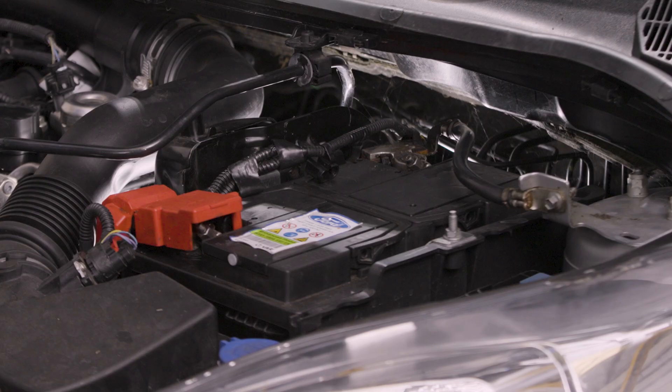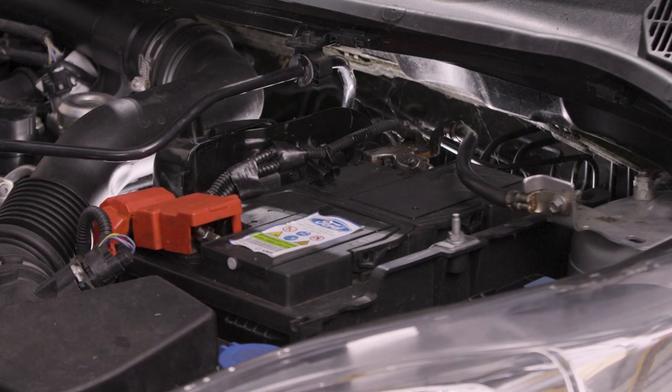You can see here on this vehicle the positive and negative connections to the battery. An ammeter detects the current flowing through it. This means the meter has to be part of the circuit, connected in series. For this, we have to break the circuit at some point and insert the meter so that the current can flow through it.